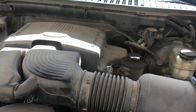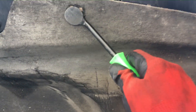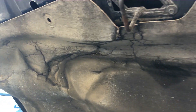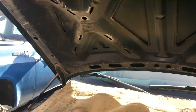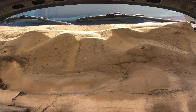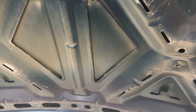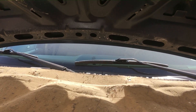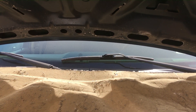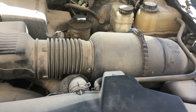First thing I'm going to do is take this cat claw tool and put it under these plastic pop rivets and pop all these off so I can remove that hood blanket, which just keeps all that hot air inside. There we go — heat blanket removed, popped all those rivets. Now all the hot air can escape from the top since heat rises. It can escape toward the windshield and even help as a defroster in winter time, which is an extra benefit as well as keeping under-hood temperatures cooler.